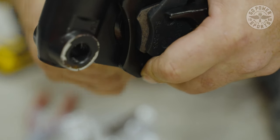Going back to the same bolt, lock washer, washer. And that's on both of them that's going in. You're going to make sure you have your gap here and this pad is sitting in properly. If this pad is not sitting in properly in this bracket, this will bind up when you bolt it down. You'll have to remove it again to make sure that pad is in there properly. You do. Okay. Going to snug in the top so you can get the bottom in, and you got to adjust to get the bottom in. Straighten up your cable. You want your slack up here where your shock is at, not down here.